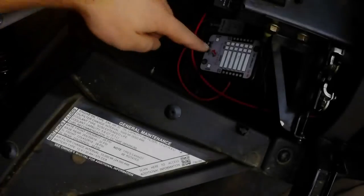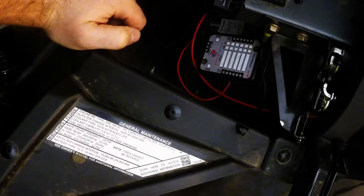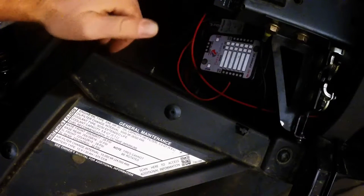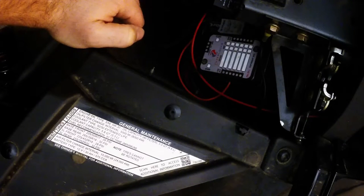Hi guys, Joe from SlingMods. Today we're going to be installing our Flosser air horn. There's a couple things I want to mention before we get started. This is the accessory fuse block available at SlingMods.com. It makes it much more convenient to install electrical accessories on your slingshot. However, it's designed to run 10 amp circuits, and when the horn's in use, it draws 20 amps. So for this video, we're going to run the power wire from the horn back to the battery. All you really need for this install is a wire crimper and stripper and a 13 millimeter wrench. Let's get started.